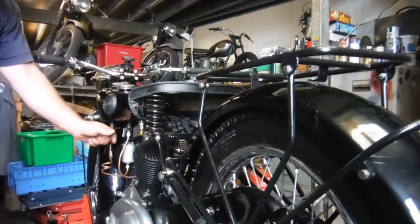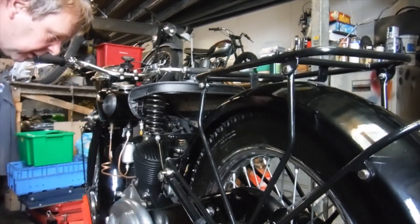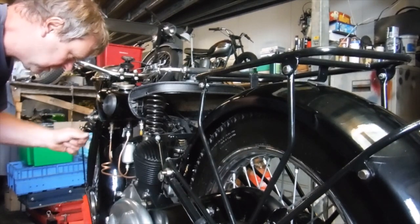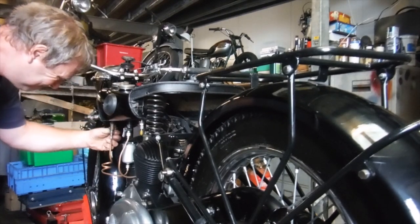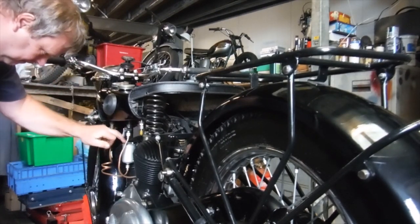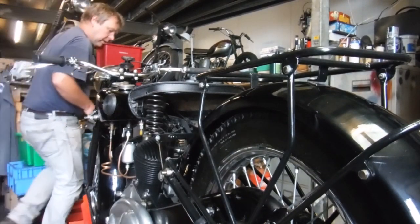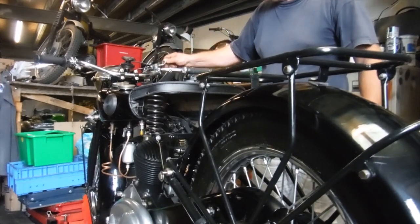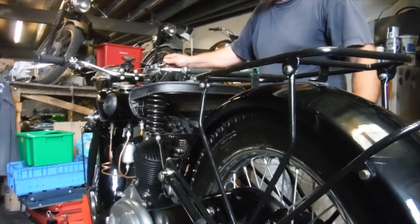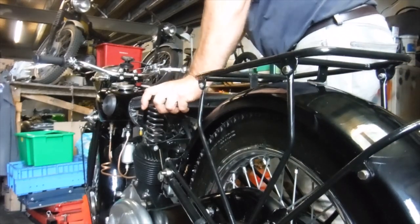I've got the oil on, there's an oil tap. And as I said in my earlier video, I've got the oil pump set on its highest setting. So I'll turn the fuel on now. Flood the carburetor a little. See if we get anything this time. Touch of retard on the ignition lever. I haven't got any choke on at the moment. Let's see what happens.